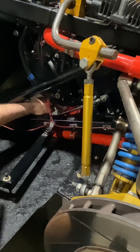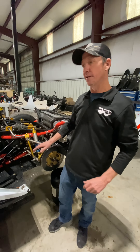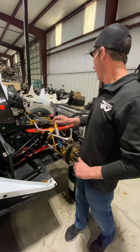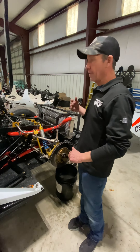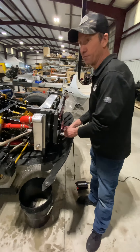Basically, we're just going to let this drain until it's completely dry and then we'll button it back up. Now that all the water's drained, go ahead and get the hose and clamp back on. Make sure that's tight and then go ahead and get your fitting tight on the radiator. Last thing, go ahead and get your battery tender plugged in and then it's ready for the winter.